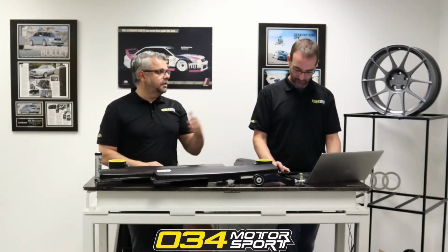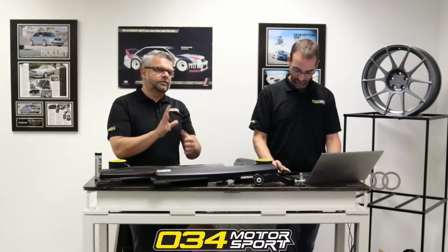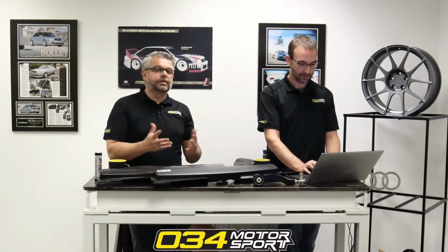Imagine a manual transmission where you can just go into the TCU and say, increase the spring diaphragm tension by 50%. You can't do that, right? So you have to take the clutch pressure plate out. You have to send it to South Bend or someone like that, and they take it all apart and put in a stiffer spring and send it back to you. And then your left leg can barely push the clutch pedal down. But that's the only way you can get more clamping force.